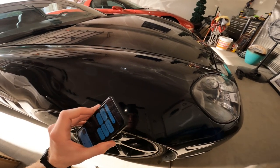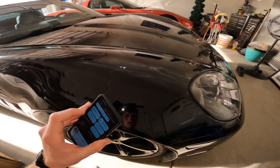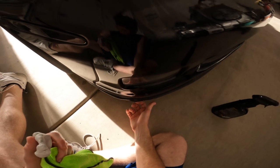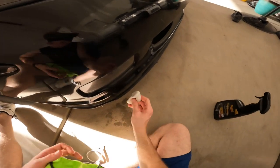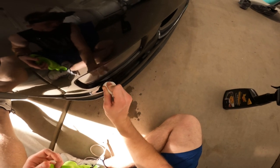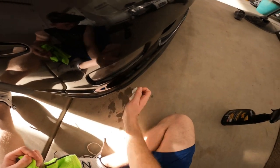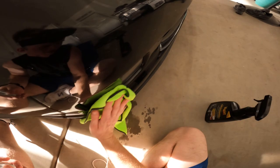Normally the next steps would be to polish the paint and then apply some wax afterwards. That's going to be done at a later date for the full car, so I'm going to save that for a little bit later. Finally, we're going to hit this last spot that looks a little bit heavier. I do plan on replacing this splitter soon, so don't give me too much crap in the comments for it. Same as the fender, we're going to apply the same methods here. Though this damage was more visible, I have a feeling it's actually going to come out even easier than the fender. I've really only been at this spot for about 30 seconds now — this, my friends, is why you should have a clay bar sitting around.